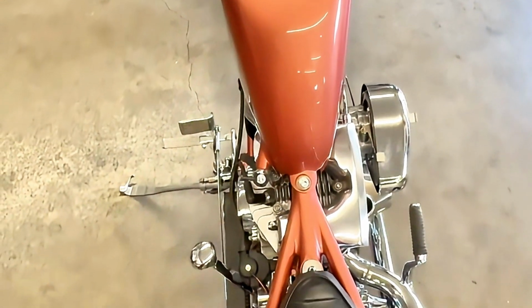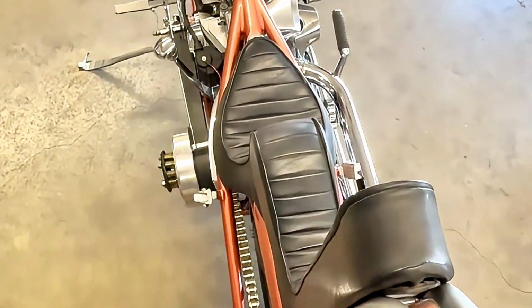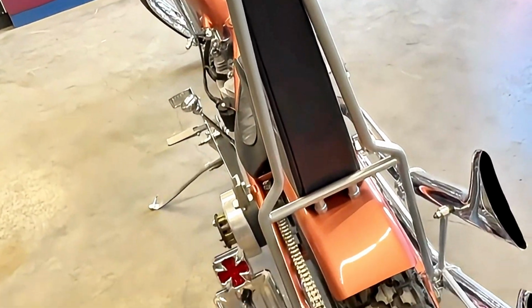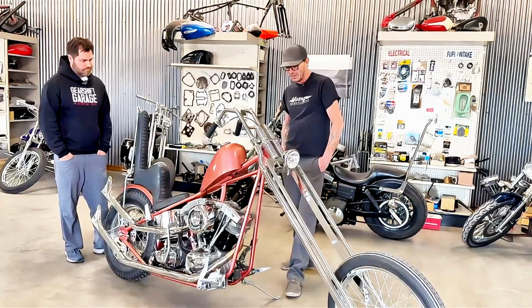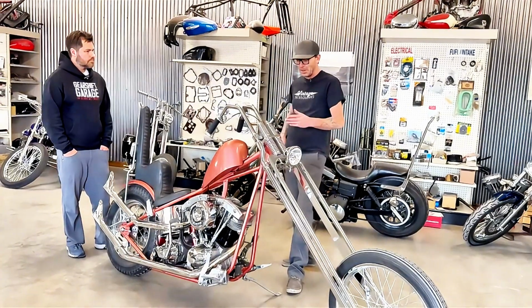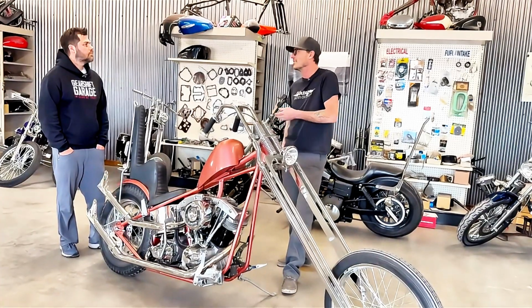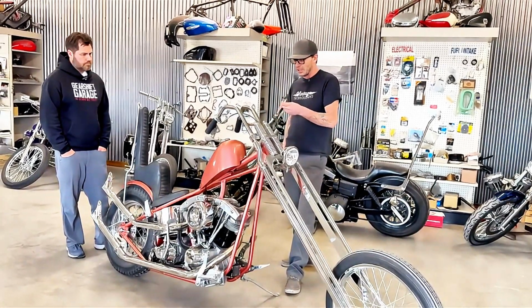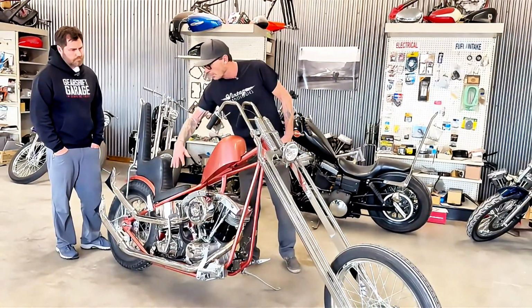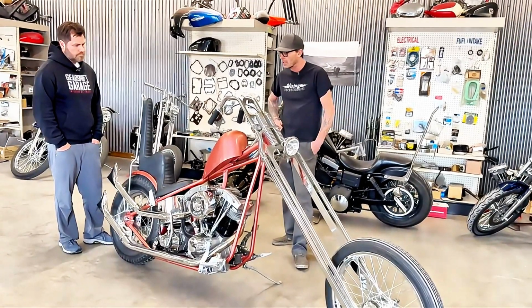And then I got through all of the mock-up and everything and had him come down to the shop and size it all up for fit and to pick a color for the gas tank and the fender. The frame was originally going to just be powder-coated black, but this ruby red grapefruit color he couldn't live without, and it was his request that I paint the frame. So painting a frame can mean a number of things. Different colors will talk to you in different fashions. A white will require a different amount of molding than a black, and so on and so forth. So, seeing this color in my mind, I knew that all of the joint seams and the welds needed to be smoothed and Frenched off. So that was a little bit extra on top of the van, but at the end of the day, he was right. It looks tremendously better with the frame painted in the color.